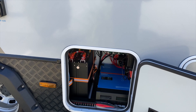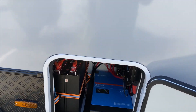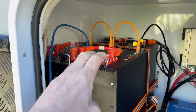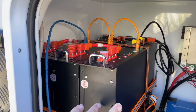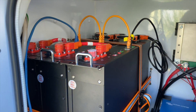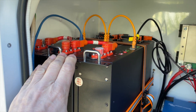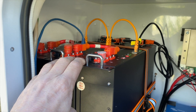The newer technology is in the rear locker here, very close to the rear wheel, moving the weight back to the double wheels in the rear. We've got three batteries — these are 200 amp hours at 12 volts, 50 amp hours at 48 volts. They're lithium batteries, pouch cells, with a five year warranty. The big difference is they're CAN bus enabled — you can see the data cable coming in at the top. There are absolutely no shunts. These batteries report to the Victron system the state of charge, the voltage, the current, and these batteries actually dictate the whole charge profile in the system.